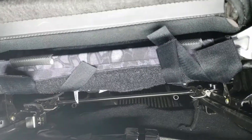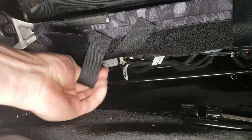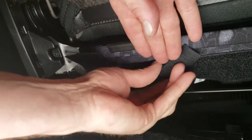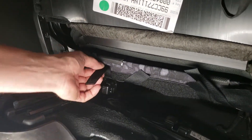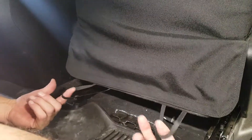Click right up to the back edge and then the other one underneath. Move it over a little if needed. Now take your scissors and trim — pinch your fingers where you're going to trim, pull it away from the seat cover, and trim the excess. Connect up the elastics by feeling underneath for where they hook up. They go a little to the inside — hook them both up.